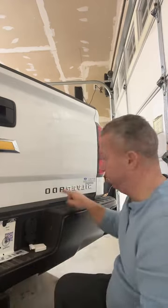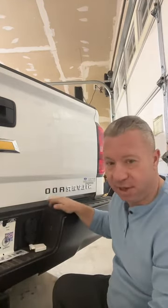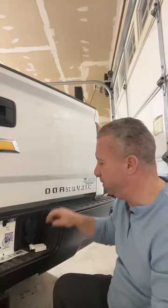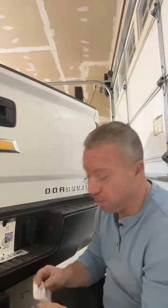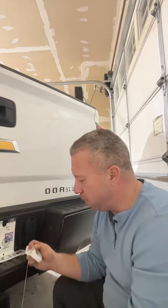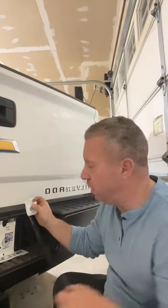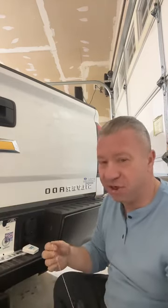Remember, adhesive is caustic to paint, which is always a challenge when removing these, especially on a very, very old car. You will get etching into the paint where those emblem stickers were. So be very careful when removing stickers, emblems, and pinstriping that's been on paint for a long time, like 15 or 20 years or longer. The paint is probably not in the best shape underneath that.